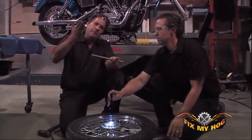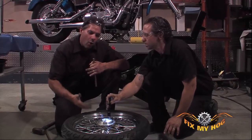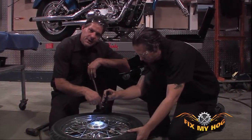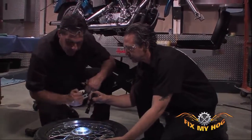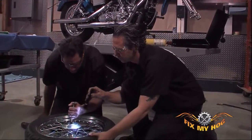All you'll do is tip it in the hub and start to drag aluminum of the hub out with the bearing race. Work at one point, move 180 degrees to the other side, move 90, move 180 away from the 90. Keep working around in small increments till that bearing comes free from the hub.